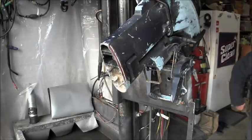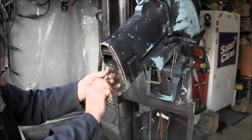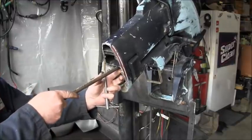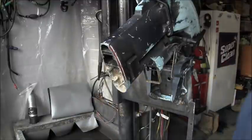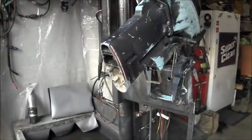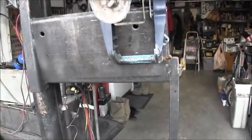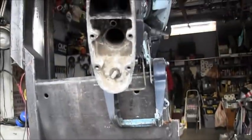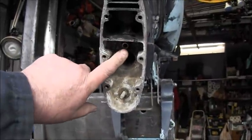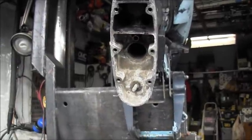And you don't want no copper where you cut it going up in there, so I got this little reamer. We'll flick them out of there and then ream it a little bit. There we go. That looks pretty good up in there. That should do it. Okay. Let's look up in there. How are we gonna look up in there? You're way too high. Look right there. And you see the water too. It's right there. See it moving? I wiggle it, my finger. I could file that a little more, but I think that'll go in just fine. We'll find out, won't we?